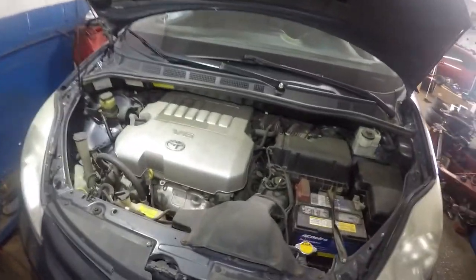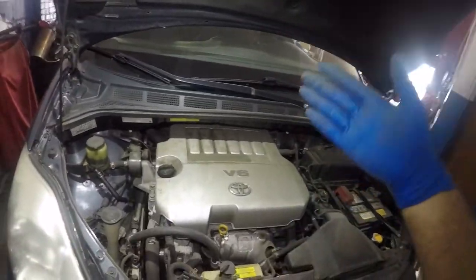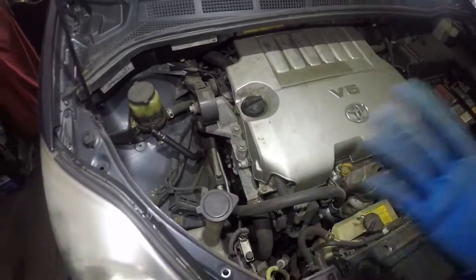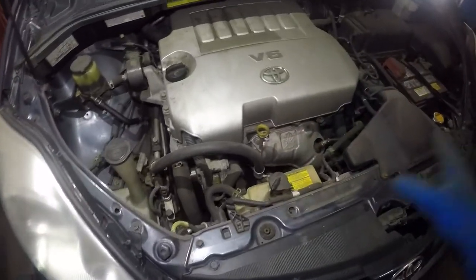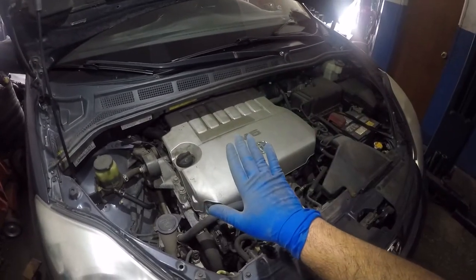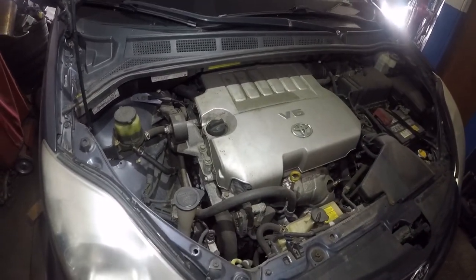Welcome to my channel. Today, at a customer's request — heat doesn't work on your vehicle, only works at high RPM. Especially on Toyotas: if you have a Highlander, Sienna, six-cylinder, you're looking at this. Even Lexus six-cylinder. They did the cooling flush, changed the water pump, whatever the scenario was, but now the heat only works when the RPM is high by pressing the gas pedal. On the highway the heat works beautiful; you come to a stop and the heat stops working.